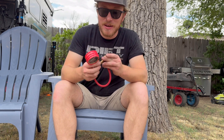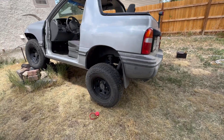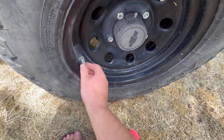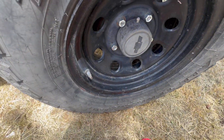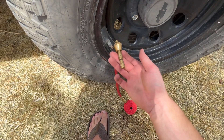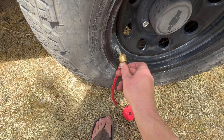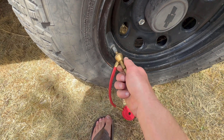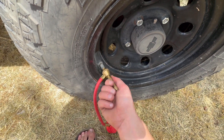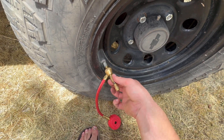I want to show you today how to operate this. If you want to buy one, there are many places you can go. Let me show you how this thing works. So you've got your four-wheeler here and you want to air down your tires. First thing you want to do is remove your valve stem cap. Little ARB end here — nice brass fittings. You're going to take it; there are a couple of places that turn on this. You've got the outer end here and the inner piece. I'm going to take the middle section and start screwing this in — screw it in fairly all the way. You don't want to have this loose on here. Don't go overboard. Now it's tight; I can't twist it with just two fingers, so that's good.